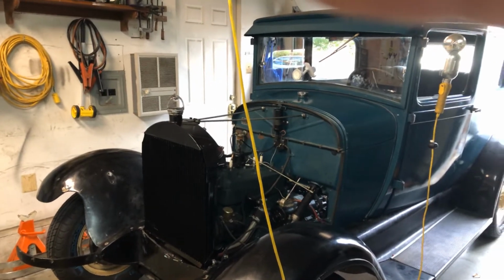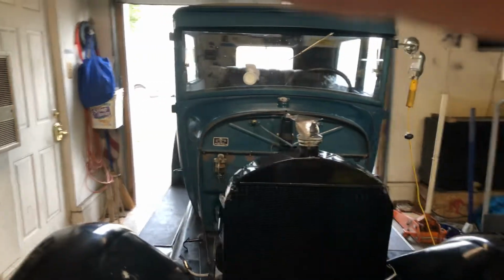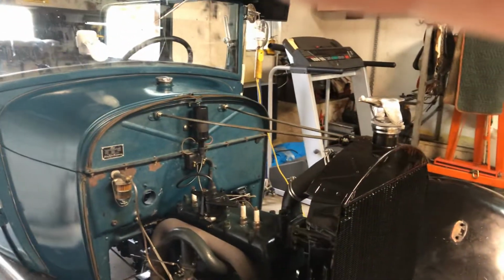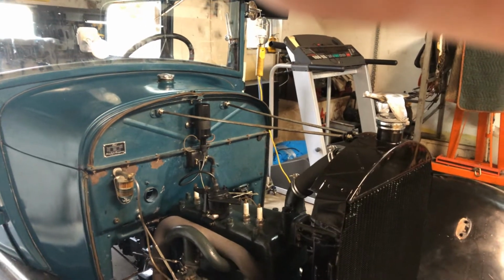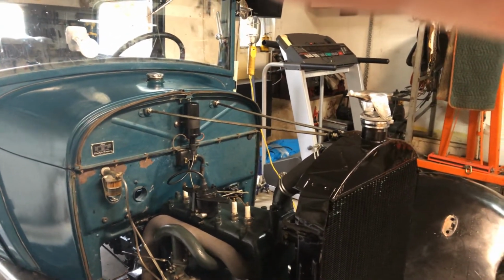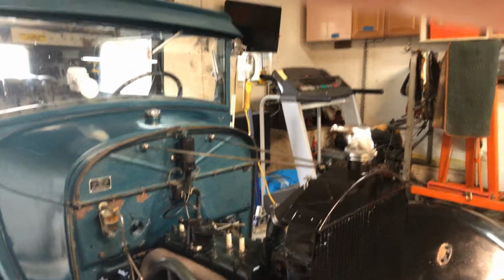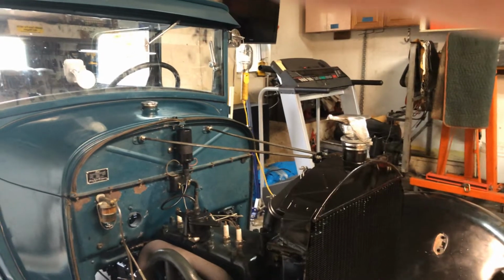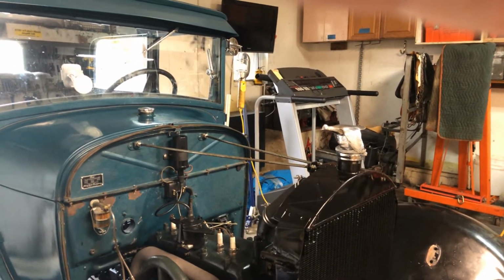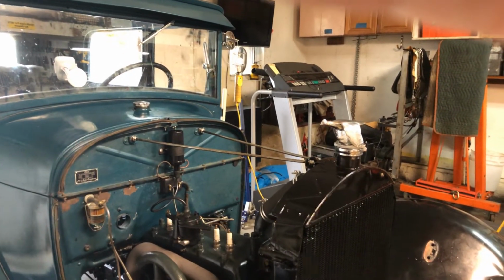Additionally, the carburetor had a Zenith carburetor on it. I don't like Zenith carburetors. Even though it's a new carburetor, I put a Tillotson on it, which is much more dependable and actually better fuel mileage if you care about fuel mileage. So this car pretty much is really sorted well. Also put a new coil in it. I put Teflon steering bushes in it. So I got all that sorted out also.